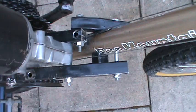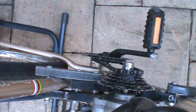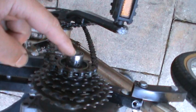Put in those bolts. Put in two little spacers here to shift the motor over this side more, so that this sprocket gets more in line, because the chain wasn't in line before. It's much better now. Everything's running smooth. Cut off the shaft here and the pin so that it's safer.